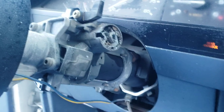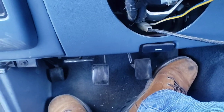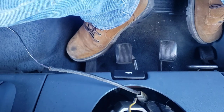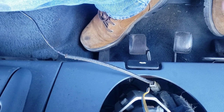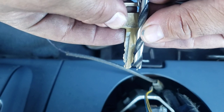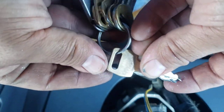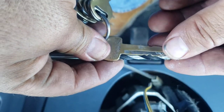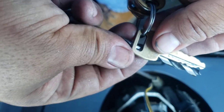Another thing that's very important: I have another key here from one of my other trucks. What I did is I got the drill bit and lined it up with the key like this, because you don't want to go too far in and damage the inside of the ignition switch. I put the drill bit next to the key to get an idea of how far to go in, because if you go all the way you're going to do more damage than you're supposed to.